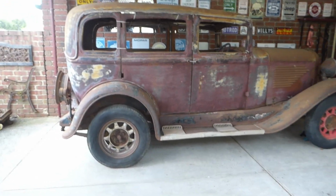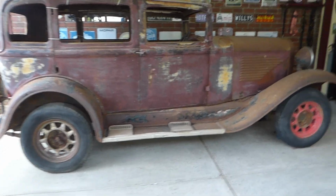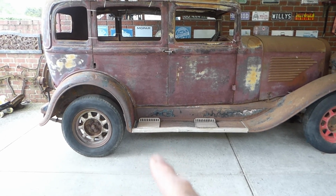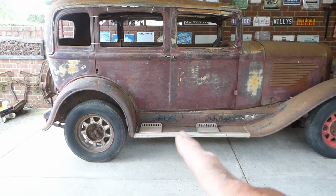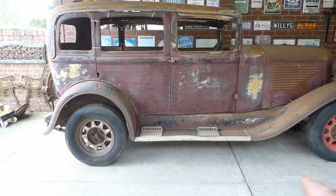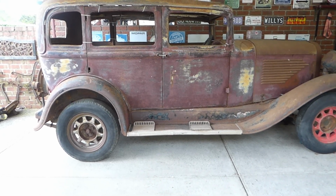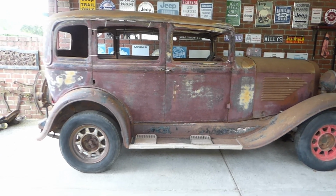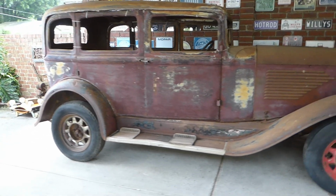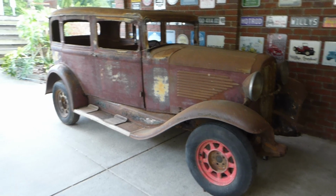One of the first things I'll do is lower the rear as well to get ride height to start with. From here to there is over 12 inches, nearly 13 inches, so what, 320 millimeters. We might be as low as 4 inches off the ground, or 100 mil off the ground, and still be legal in this country, and that is what the 300 SRT rides at. It'll be interesting to see. I always kicked myself when I haven't had enough to start with.